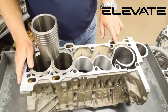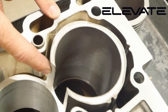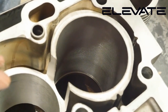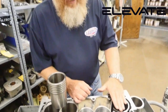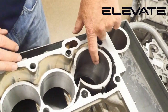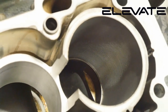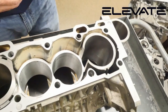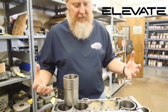I wanted to show you one of the inherent weaknesses that we found in this Volvo block design. You could see part of the stock sleeve — we left it in place on this demo block. If you look down in this area right here, the aluminum is infused into the stock sleeve. The stock sleeve has a serration or a threaded design on the outside of it. It's put down into a mold, and the aluminum is cast around the stock sleeve. When you see these ridges down here, that's the aluminum breaking through. The downside under performance is if you really put a lot of boost in the motor, this area where the aluminum breaks through can crack. That's part of the reason we come up with a hardened sleeve, a thicker sleeve, so that you can throw as much boost in it as you want.